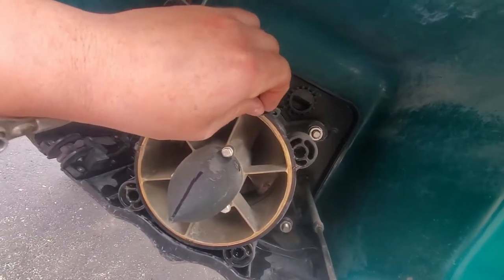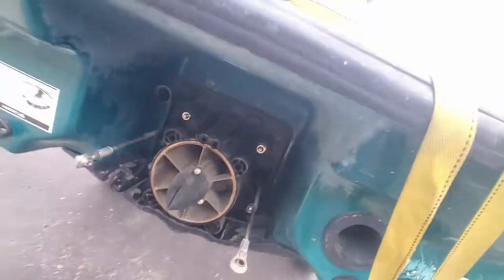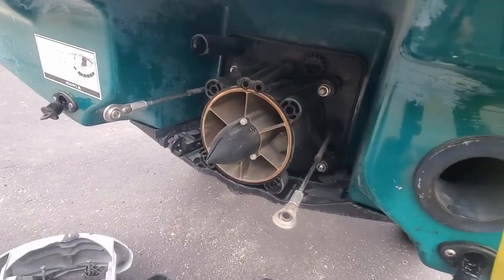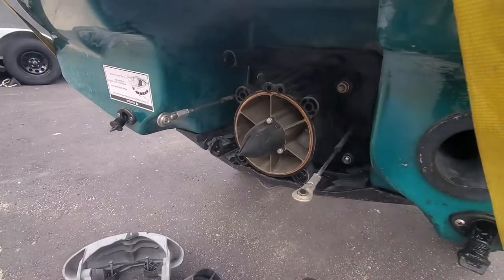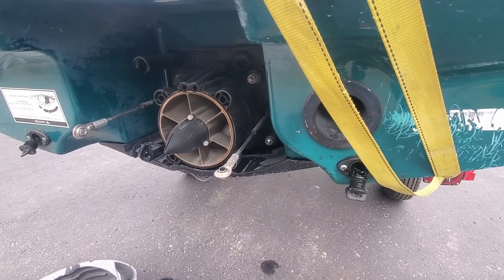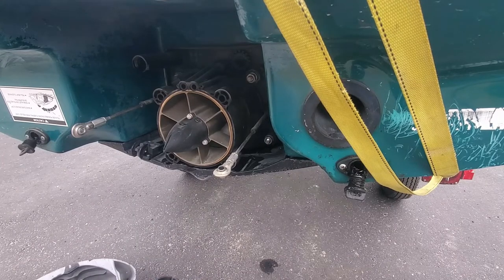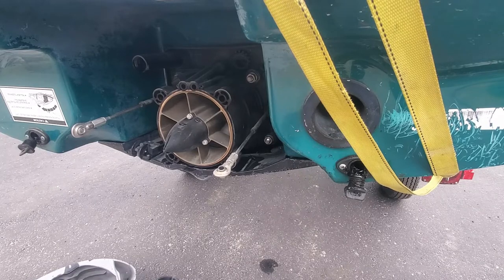I normally replace them with new ones, which come in our kit from OSD Marine. We'll see what cone this is. Maybe that's already an anti-rattle cone, but I do keep anti-rattle cone and oil kits available for all my projects. So I always order another one every time I use one. So we have oil and everything for this. We have a wear ring. We have a Delrin wear ring from OSD as well.